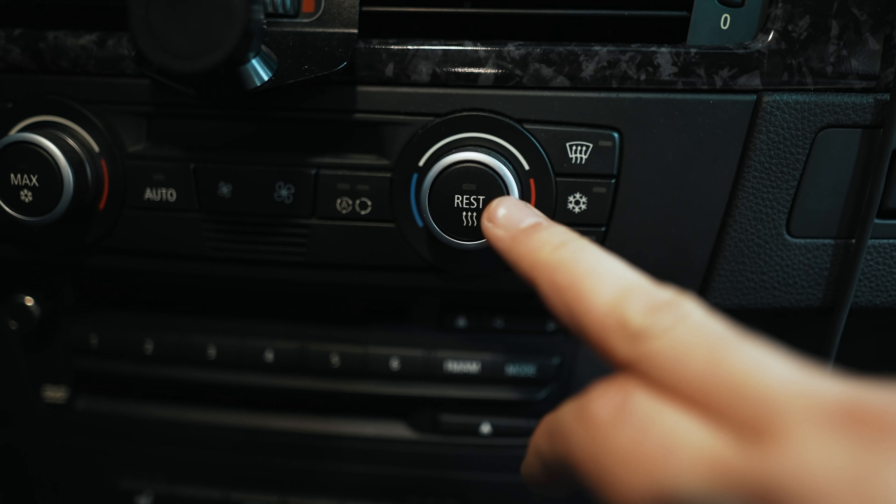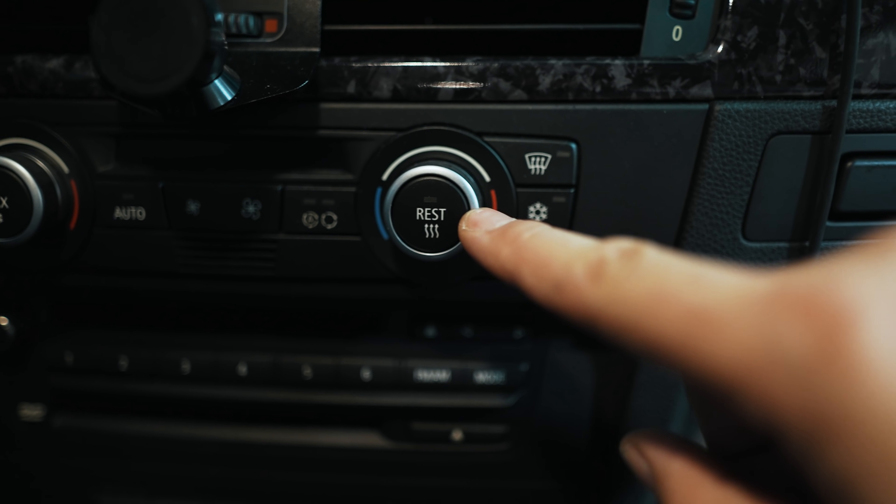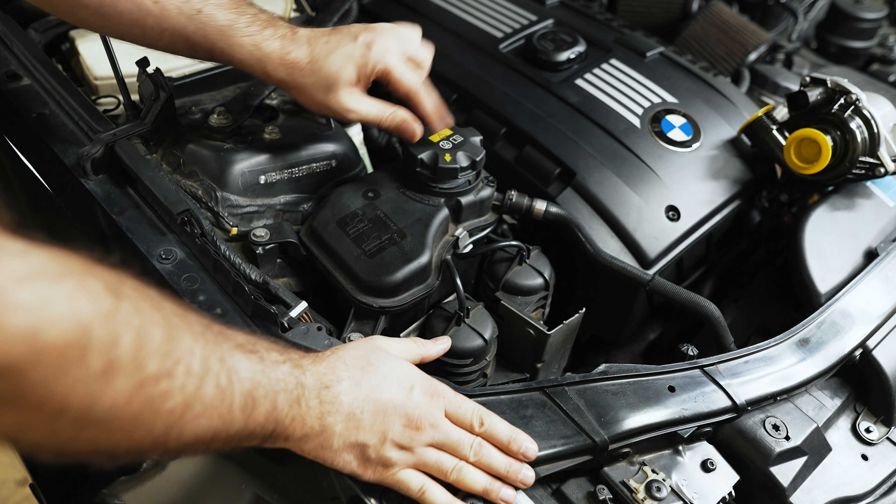Back in the day you still had to run a turbo timer to keep the engine running for a couple minutes as you walked away, just to pump coolant and oil through the turbos to make them last. With this pump you can cool the turbos right when you shut the car off without thinking about it. There's also a feature where you could press a button to pump fluid through your heater core and stay warm on a winter's day without keeping the engine running.